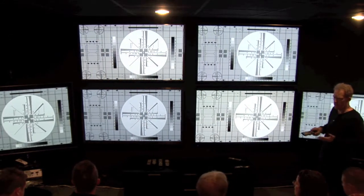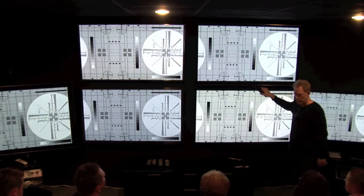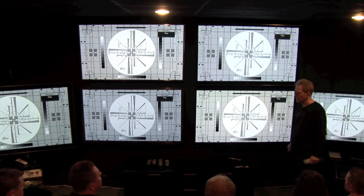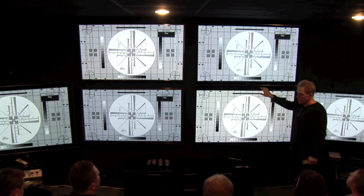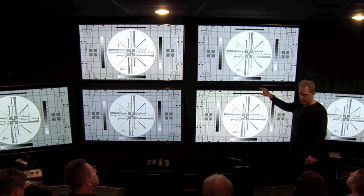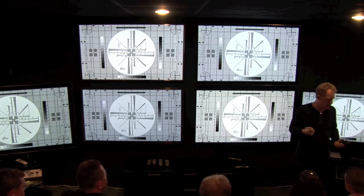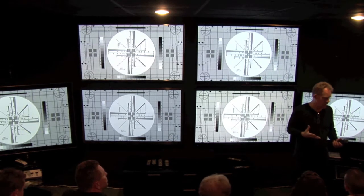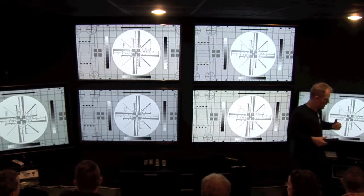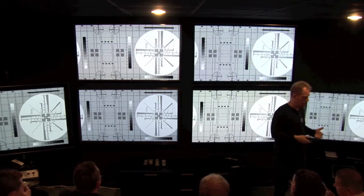The reality is that in a moving picture in a movie, you're not going to perceive this loss of resolution. I'll put the motion enhancement on low on the Sharp Elite, and you'll see it'll sharpen up the picture very nicely. In my opinion, this probably has the best interpolation circuitry processing of any LED I've ever seen. In the low setting, it does not give you that soap opera effect, but it cleans up and sharpens the image with motion dramatically. Whereas every one of the other displays in the room will give you that sharpened-up looking picture, but at the same time it's going to give you this odd motion in film.